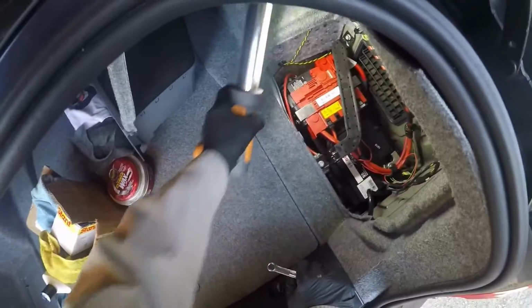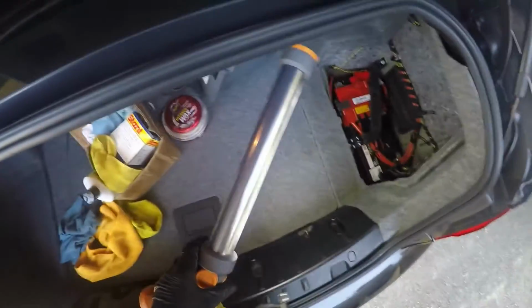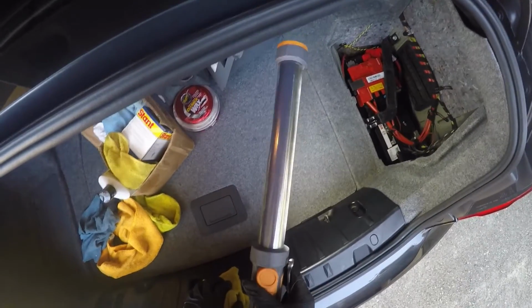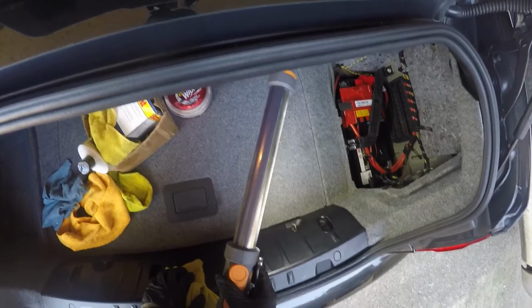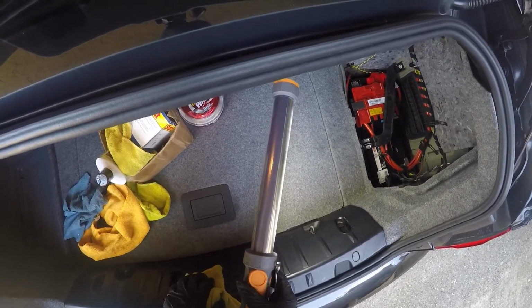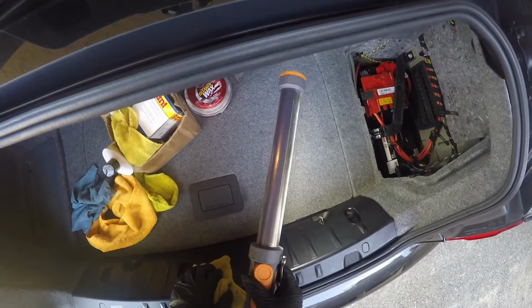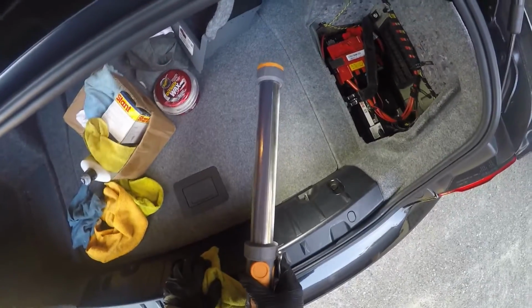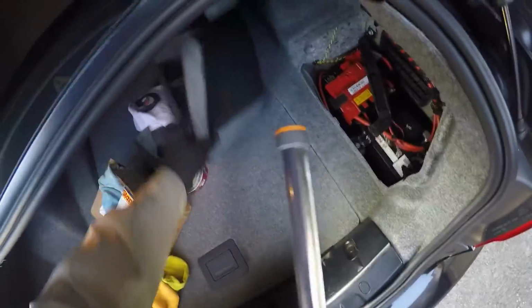If you come back here and hook a power and ground and then turn your battery charger on to high, well, you risk burning out every module, you risk blowing up every airbag. It's really stupid. I never heard or seen a thing until it actually happened, and I watched my partner have to get a hold of the owner and let him know that his car is now totaled because the airbags all deployed, plus the windshield busted out of it. It was a big insurance claim, and it ended up costing a deductible on our insurance, and had them basically total the car and write the guy a check for his car.